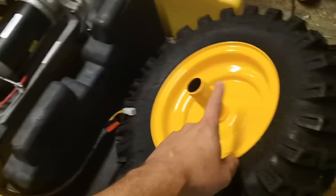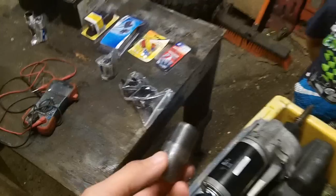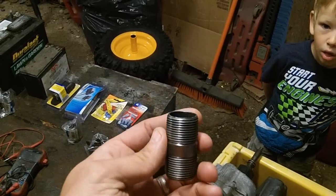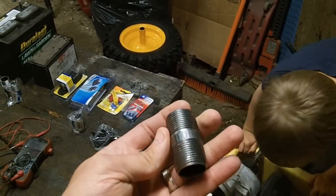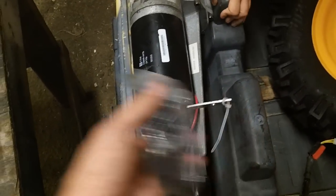What we're going to do is, on the end of this, create an insert that produces a 3/4-inch keyway, using nothing more than generic 2-inch, 3/4-inch pipe that you buy at a hardware store. The pipe is seamed on one side on the inside, so we're going to use that as the side we cut out later. Along with this, you've got these ends which are rubber mount, and they come with mounting brackets, which makes it nice and easy.